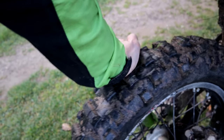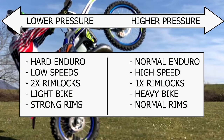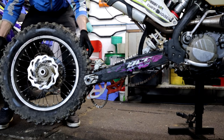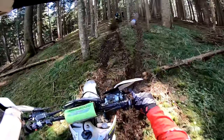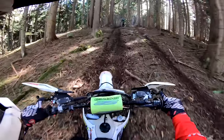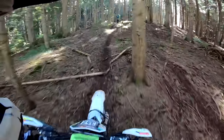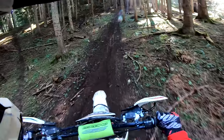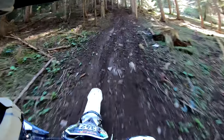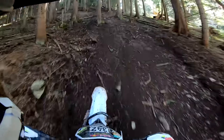For slow driving in difficult conditions like mud and sand, I suggest lower pressure. But I must mention that with lower pressure you increase the chances of damaging the rim and also of getting pinch flats. The lower the tire pressure, the more grip on ground you will have, but don't overdo it. If the tire is at really low pressure, the dirt bike is harder to control at higher speeds and the wheel starts to kick around on stones. Try to find the best pressure for you, which works in slower terrain but also in faster parts of the track.